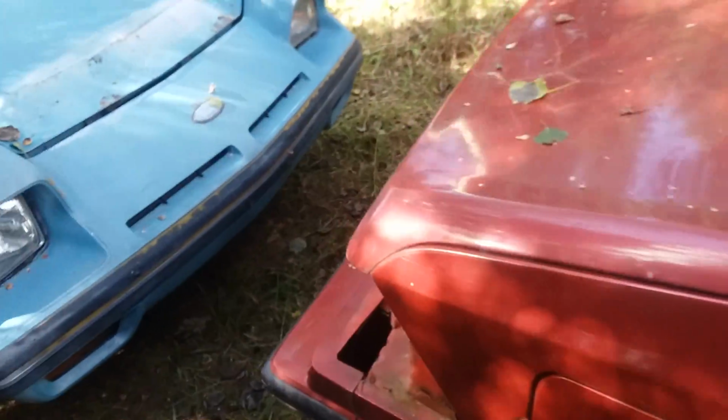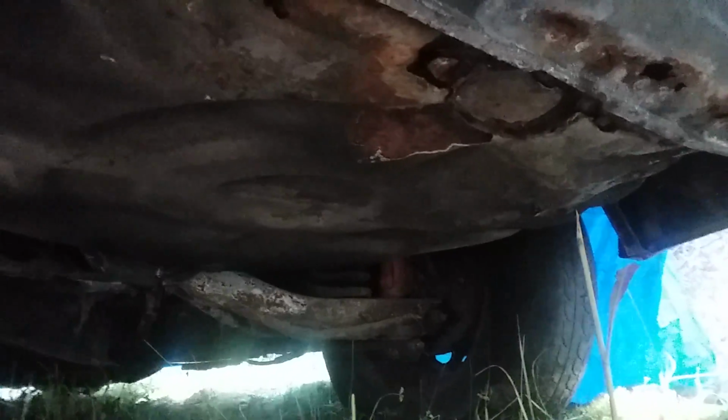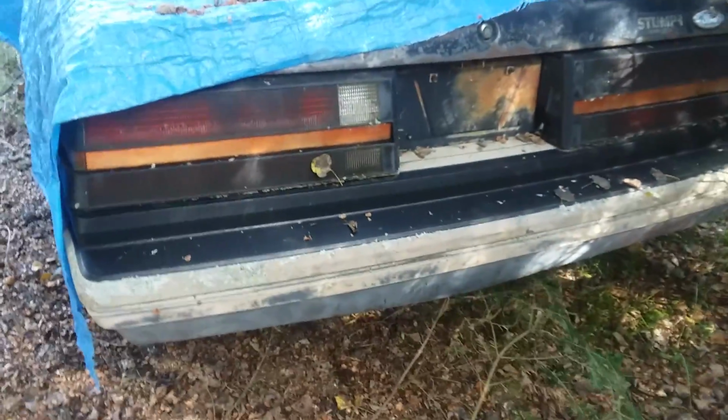Another issue is the spare tire compartment. Maybe I got one to show you. These spare tire compartments hold water too, because it's a recessed part of the car. You can see some of it. So it holds water, and there's an oval access hatch where you can go in. I don't know why Ford had those there, but they didn't work too well. They were really good at collecting water, and then water didn't go out of them, because they sealed so strangely, but they did, because it's just rubber around an oval tin cover. Somehow water gets in there and it never comes out, and it just rots out the entire wheel well.